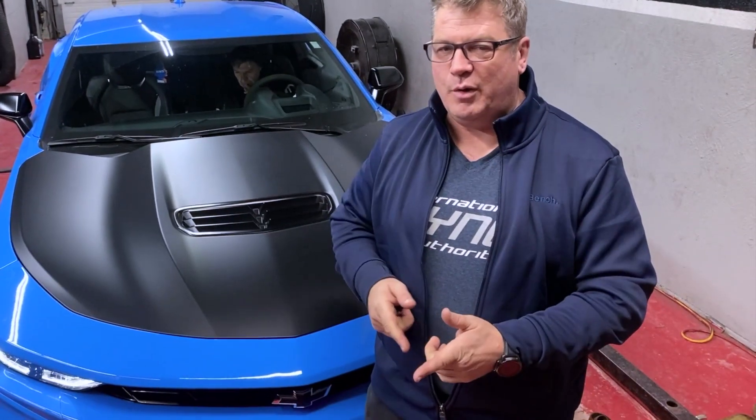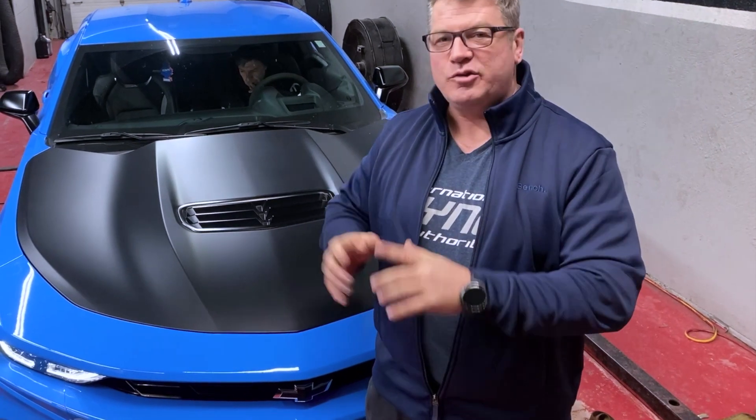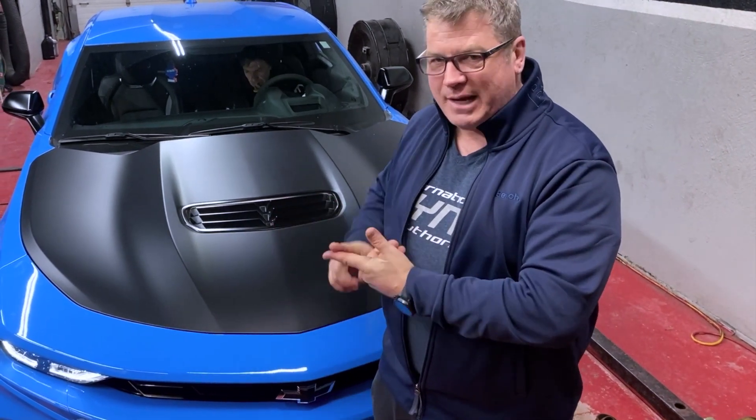The manifold porting and exhaust system will probably run okay, but right after you put long tube headers, you're going to have to get your way to a dyno shop very quickly. So he's here today to have this tested and tuned. We'll license it, start working through the process — get the air fuel correct, get the air modeling correct, make it idle, make it start, make it run good, and then we'll see what we can do for horsepower.